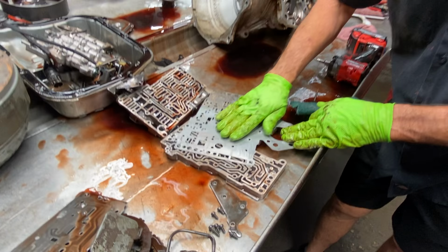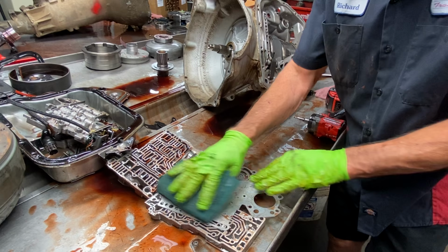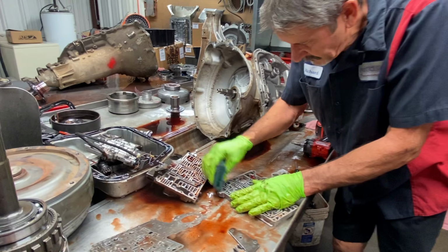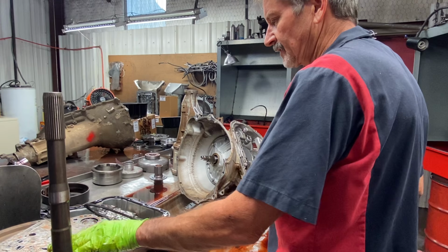You can't really see it, but when I take it over here and put it in my solvent and polish this down, when I first start, it's really loud. And then when I get done, the Scotch-Brite's just smooth. So it takes all that rough edginess off. Even come in here, take your file or your Scotch-Brite and just make sure, mainly around the edges where you're bumping it and stuff like that, clean that all up really good, put it all back together, nice. Night and day difference.